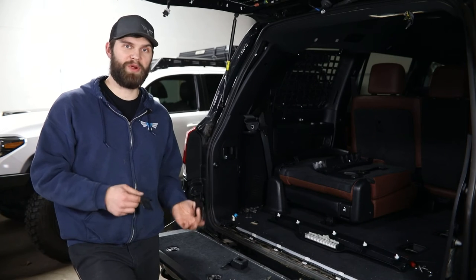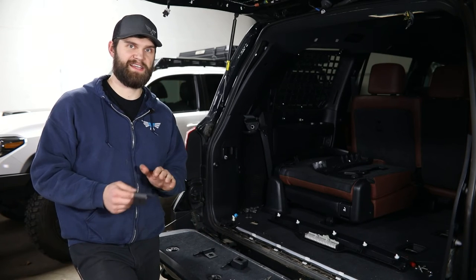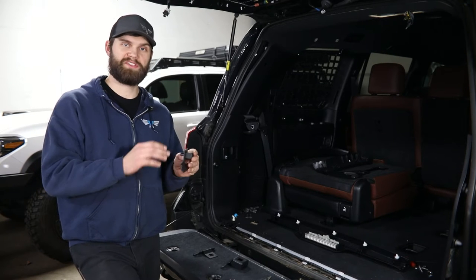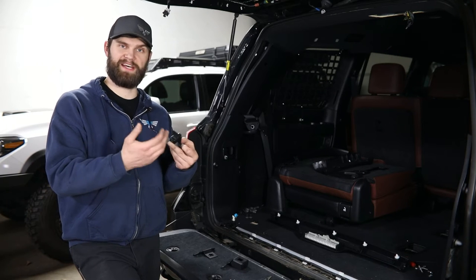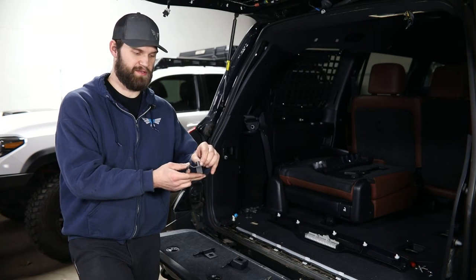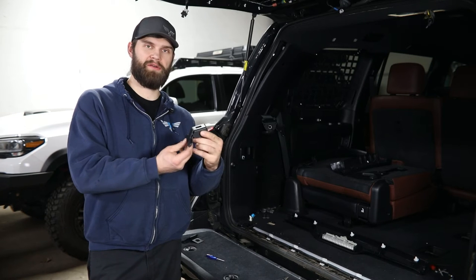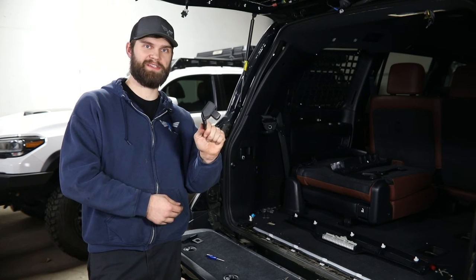You will want to save these screws because you'll use them to reinstall this camera into our bracket. Next, open up your camera bracket kit. There are a couple of different mounting brackets in the kit because it's designed to fit a couple of different vehicle models and year ranges, so find the one that corresponds with your camera design. Make sure you install the camera into the bracket in the same orientation as it was mounted on the vehicle so that the top is still the top, and then reinstall it using the original factory Phillips head screws. Once the camera is installed, it will clamshell with the back half of the bracket and the plug will be inserted from the back later on. You can set this assembly to the side for now.